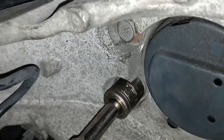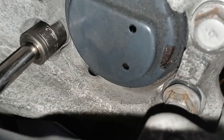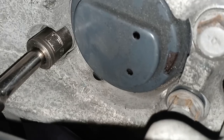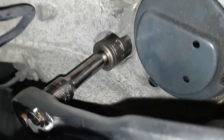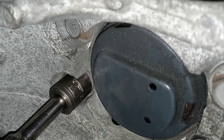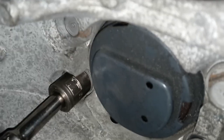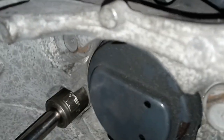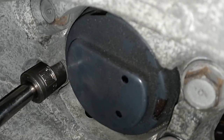This is part six, probably. You can see the upper bolts of the axle and those are the two lower bolts. The first lower one came out really easily. The second lower one required all kinds of contraptions. For the two up top, we used the 17mm with a short extender and a 3/8ths ratchet, plus the extender bar — my assistant pulled from the top and we got those two loose. Now that all four bolts are loose, we're going to tap the back of the hub out to the outside. Since there's no axle connected, we won't need a hub buster like you would for a front wheel drive car.